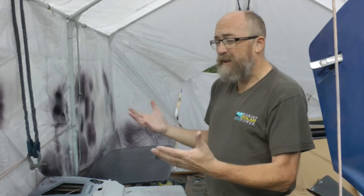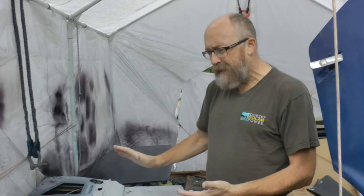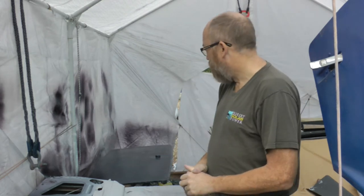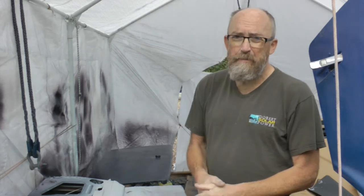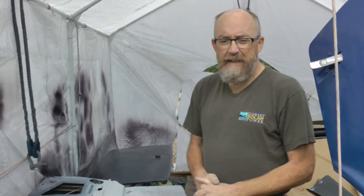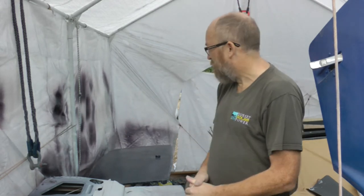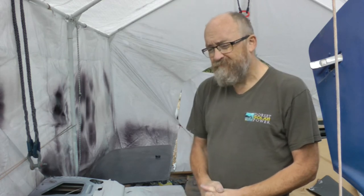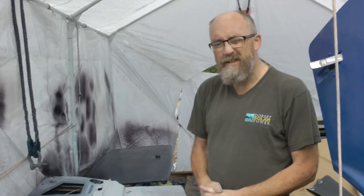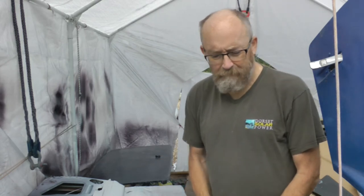On this occasion, although I'm undercover, it just gets droplets in. Some drops have landed on the panels and caused watermarks, so I've had to sand them back again. We're going to do another colour coat today, just to try and hopefully cover that up. If not, then I'm going to have to sand it back to primer again. That'll be the fourth time that I've done the tailgate, which is a bit annoying. I'm really starting to get a bit hacked off with having to keep redoing it. Hopefully this time we'll get it right. Hopefully.